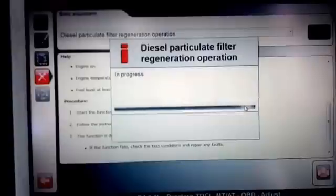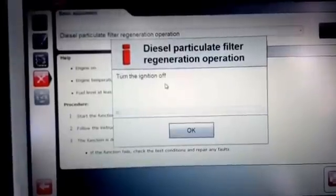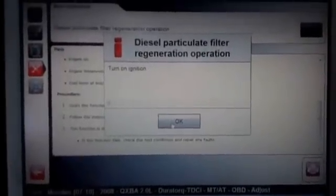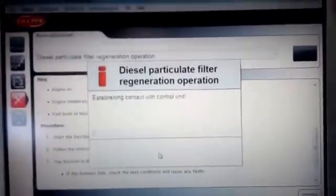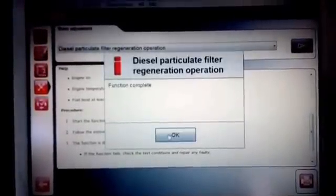Now that we've got to the final stages and it shows 'in progress', it will tell us if it's successful or failed. It's asking me to turn the ignition off, so I'll press that button there - that's the ignition off. I'll go back, press okay, then turn the ignition on so all the lights come on. Now it's going to scan and establish the communication with the control unit being a wireless one. Function complete - diesel particulate filter regeneration successful.